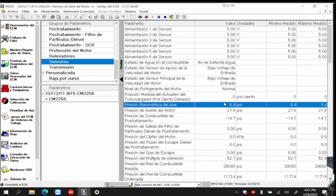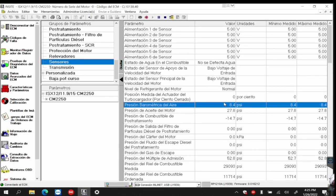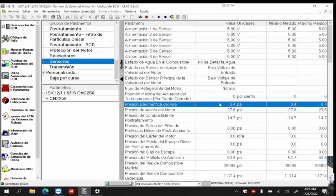Knowing what values to expect is what helps me diagnose quickly and efficiently. For the thermostat: the temperature gradually increases, stops, and drops one or two degrees, then starts again — that tells me the thermostat opened. If it may not open enough, the pause will be almost imperceptible. Find a car that is good so you have a point of comparison. Whether I measure a Cummins, a Detroit, a Cat, or a Maxi-Force, they should all show similar barometric pressure — 14.7 pounds per square inch, which is the pressure at sea level. You have to know how much it should be so you know what's wrong.